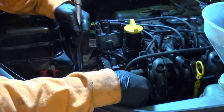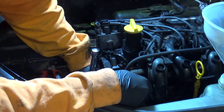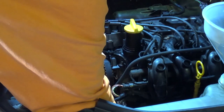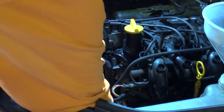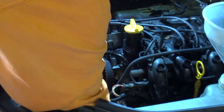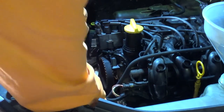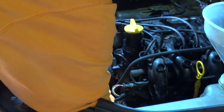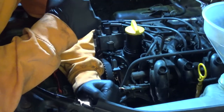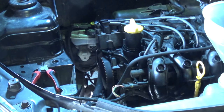After it's torqued, the next step is to get a breaker bar and apply the angle torque. I did that by Tipp-Exing the bolt and the pulley and then seeing how far the marks had turned. I was just about able to do it given the space available for the bar. After filling the coolant up, give it a start.